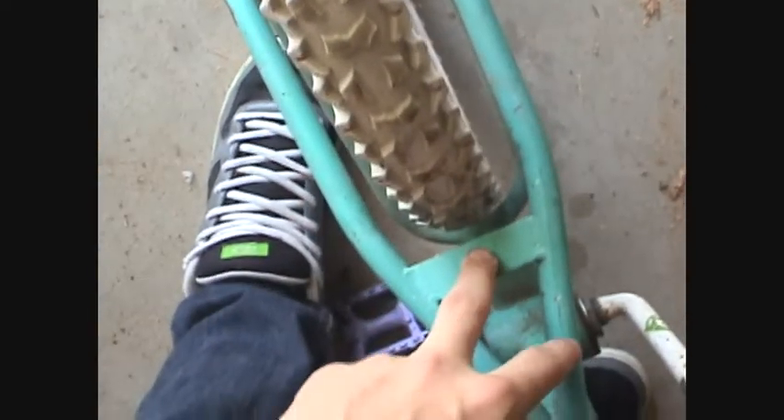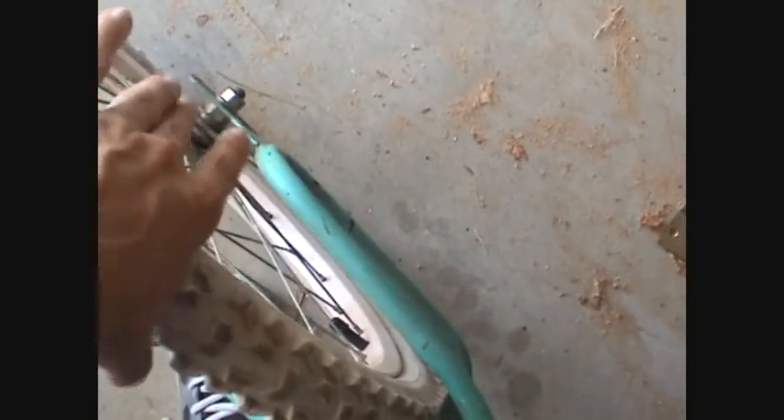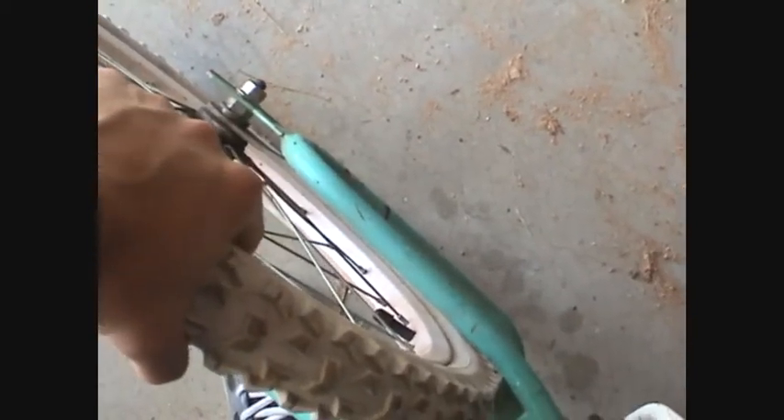I was planning to have some sort of — I can't use that hole because I want to mount a brake and then run cable up, because right now it only has a pedal brake and I don't really want just a pedal brake. So I was thinking about bolting something up here, having a hinge go here, and have a little piece of metal sticking out with some angle iron coming out, then bolt the motor to that, and kind of have a spring or turnbuckle on there to clamp it down. Then I'd have just a regular bike peg on the motor.